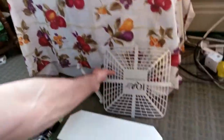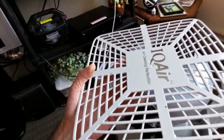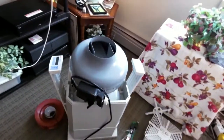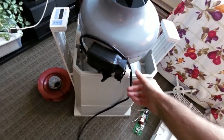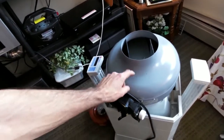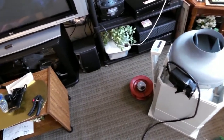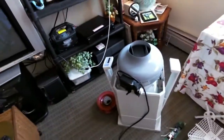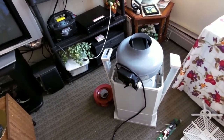Also, that flat piece on top of their fan was blocking a lot of the air and causing unnecessary resistance. This way there is no air resistance because it's directly pulling in from the filter. So I think this modified way is actually going to be an improved method. I can also adjust the speed of the fan with the speed adjustment control. These fans use a lot less energy — I think these fans are around 80 watts, and the IQ Air pulls 215 watts on high power — so this will be much more energy efficient.